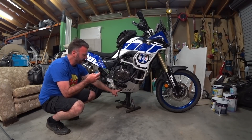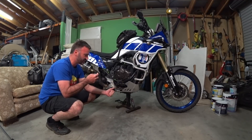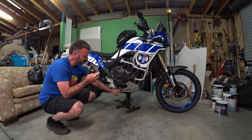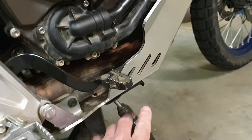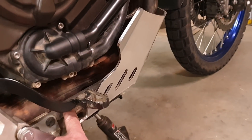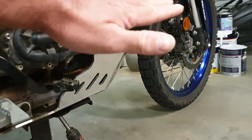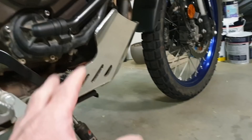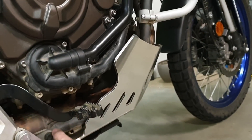The manual says: 'Do not lift the motorcycle from under the skid plate or by the subframe members.' The reason for this is not that these subframe members are weak — it's because you can't lift from the tin stone guard as it'll punch a hole through it. And you can't just put a flat jack onto these two bars because they're at different levels on each side of the bike, so the bike won't sit level and will slide off or fall over. That's the actual reason. Obviously once you have a bash plate on you can lift from it.